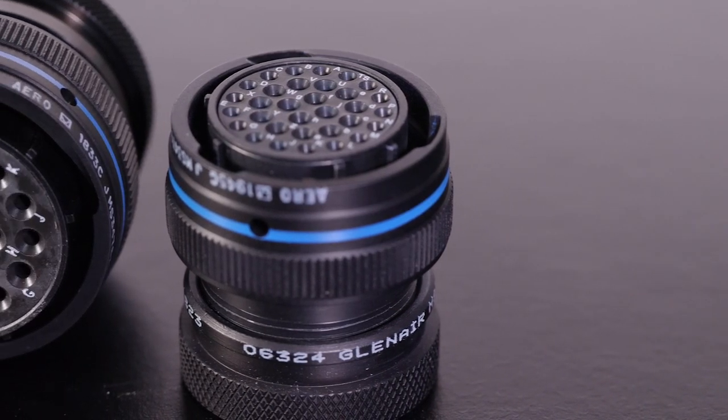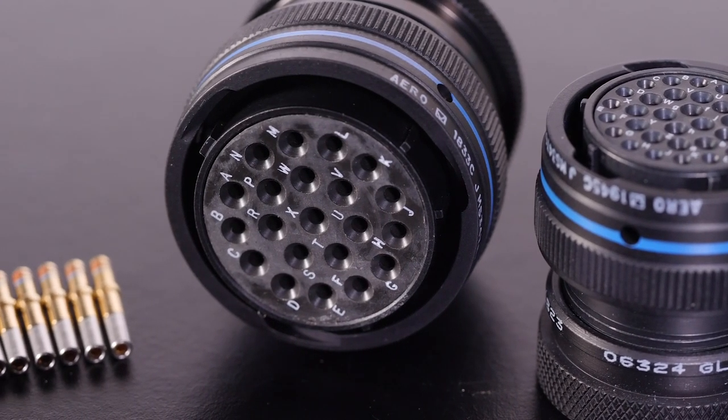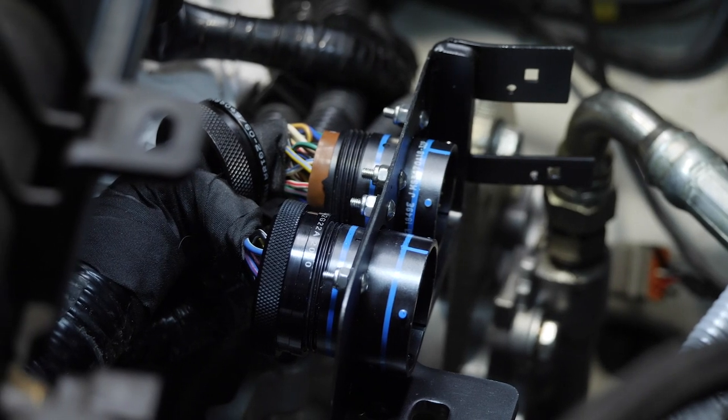This is a question we quite often get asked in our wiring webinars — are there alternatives to the mega-dollar Autosport connectors? The answer is yes. Obviously these are not going to be the same quality or quite the same reliability as a genuine Autosport connector, but they're definitely a good step up over the OE connectors. They also provide a sensible alternative to not putting a bulkhead connector in your harness at all, which becomes awkward if you need to remove the engine — instead of disconnecting at the bulkhead, you're forced to disconnect every sensor and actuator on the engine itself, which is much more time-consuming.